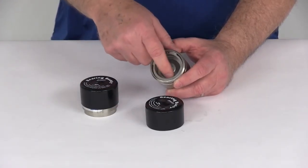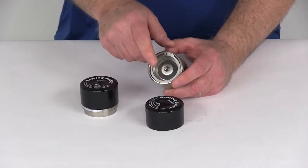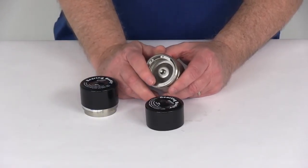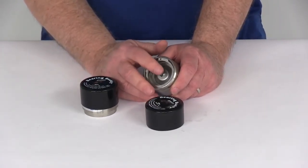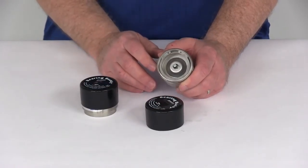When you're pumping it up, it will maintain a slight controlled pressure with that spring-loaded piston — about 3 PSI — and that'll help prevent any water from entering the hub. It will also prevent overfilling and any rear seal damage to your hub because it has an automatic pressure relief feature. When you're pumping grease in and it starts to fill up, the grease will seep around the piston edges and into the barrel when it's full.